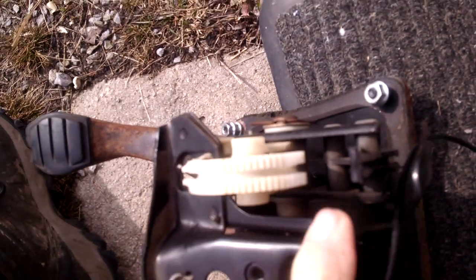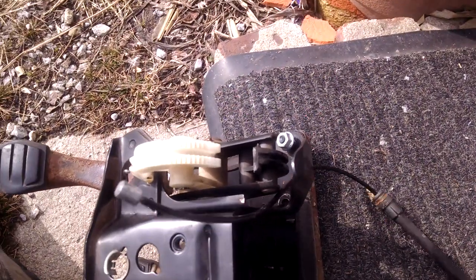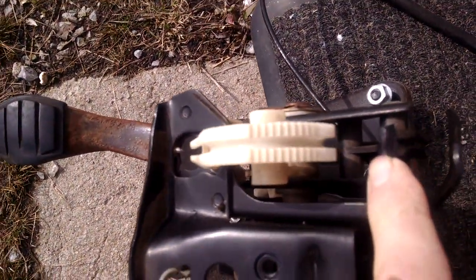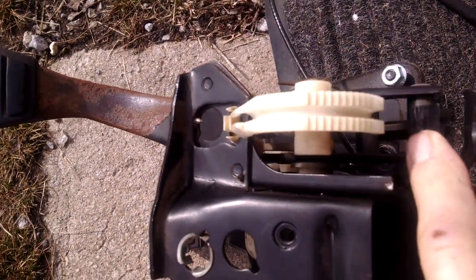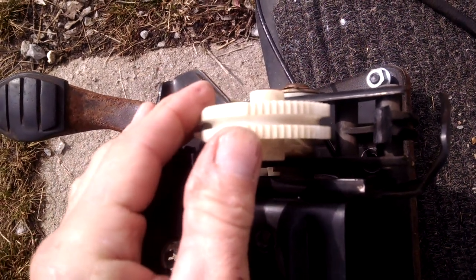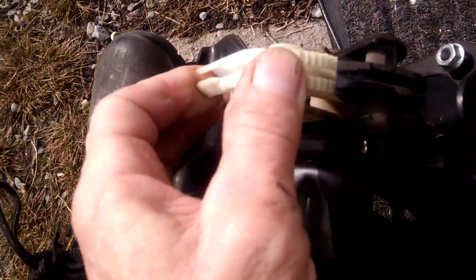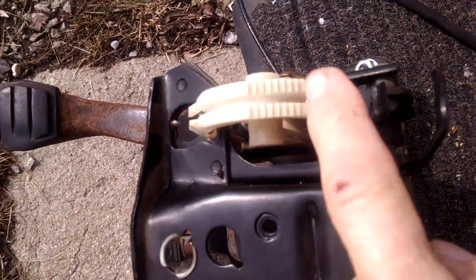What you can do is glue this together and then adjust the cable with shims at the throw-out bearing, which is kind of funky. But if you have more than one Renault Alliance, always keep this particular piece of plastic — connected to the foot pedal — as a spare, in case you hear constant clicking, because that clicking happens when this piece is stripped, and it usually strips about there.